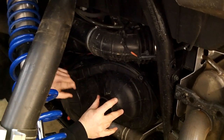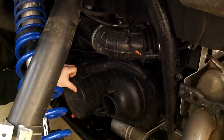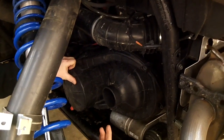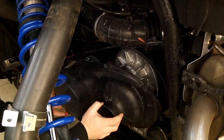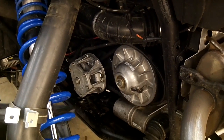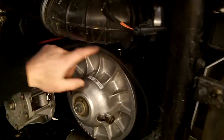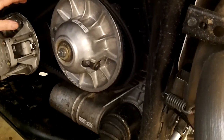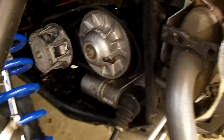And then you'll have your clutch cover bolts. You have 8-10 clutch cover bolts all the way around the machine. On this one, it's an 8mm socket. Just take them out, loosen them up, pull it off. The only thing to watch there is when you take it apart, there's a little foam gasket in here all the way around. 99% of the time it's going to stay there and not have any issues. But just watch for it so you don't wreck it or tear it.